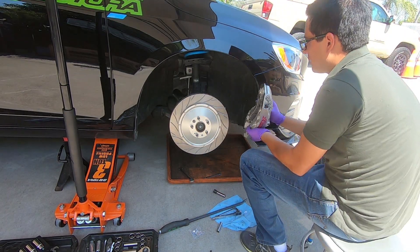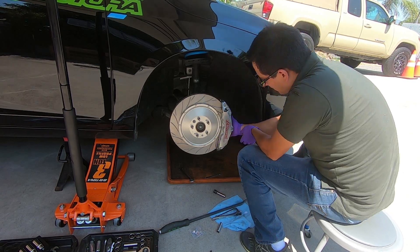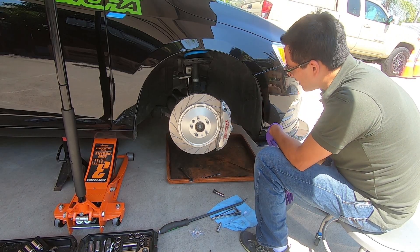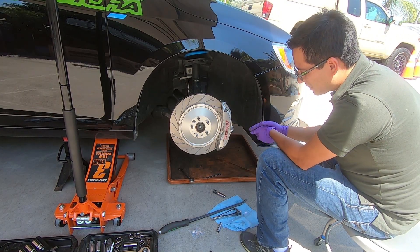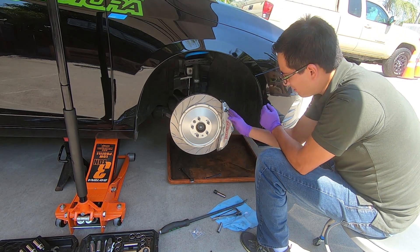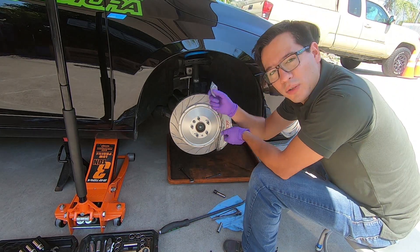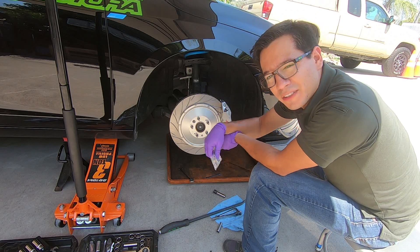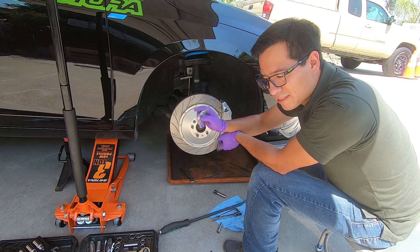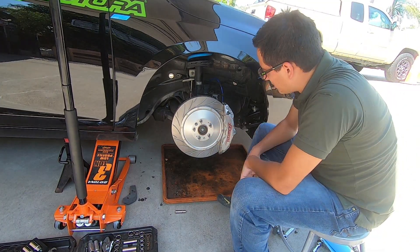Let's see how these look going on the relocation bracket. You can see how straight up that bleed valve is. 12.5 degrees isn't going to bring it all the way down obviously, but you're still going to get some benefits — whereas before it was cocked up a little bit. So we're going to tighten that down with our new hardware at 40 foot-pounds. If you want a detailed install, go check that out — link is in the description below. And just like that, we have the awesome new kit installed.